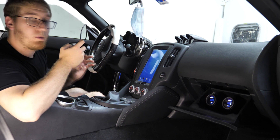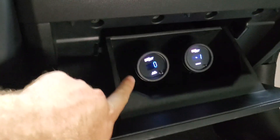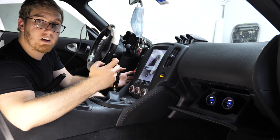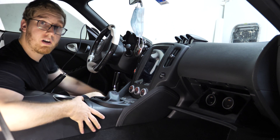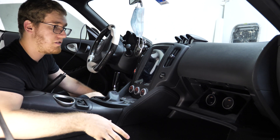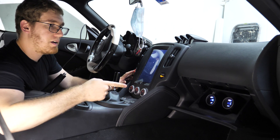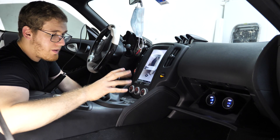That first problem is fixed — hopefully no more 100 psi hitting the fuel lines. Checking fuel pressure now, we're sitting at zero since we drained the fuel when unplugging the lines. Hitting ignition on, I don't hear the fuel pumps firing. But with the secondary pump switch enabled for the Radium system — which has two pumps, the second controlled by a switch — hitting the on button, I can hear that second pump firing and fuel pressure has gotten up to 44 psi.